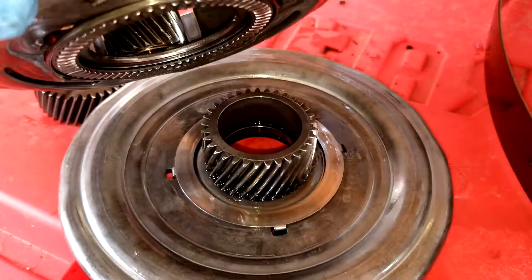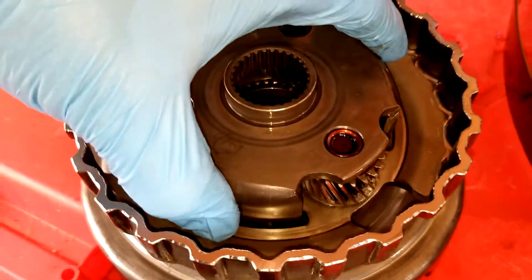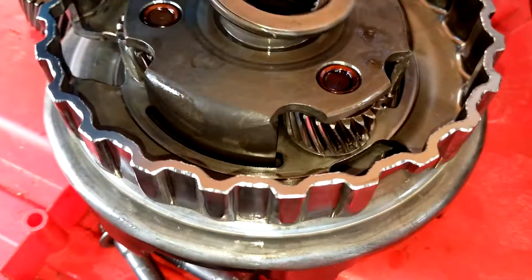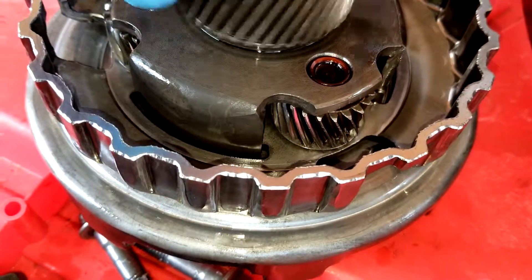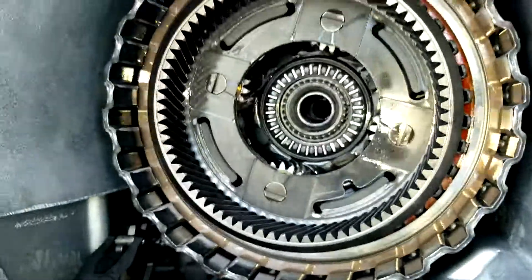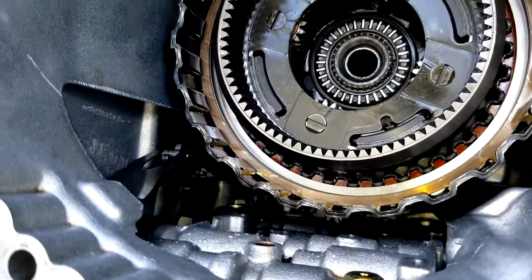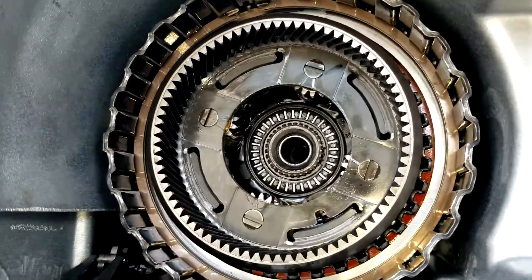Let's put this back on there, and slowly put this piece back on here just the way it was. Then this one goes back on here so I have a good picture of it. Looking inside of here, I have a needle bearing in here, and that one will probably come out right now, but there's a snap ring in there I need to remove once I get the back shaft off. I'm going to loosen that right now.